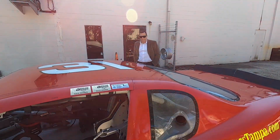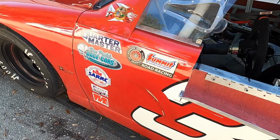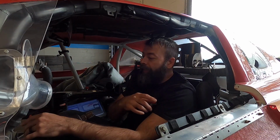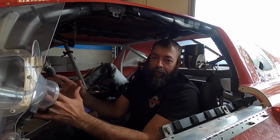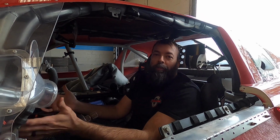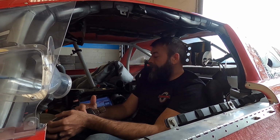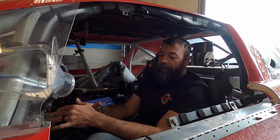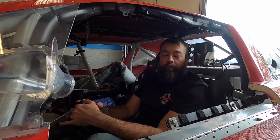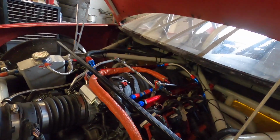Really curious to see how the changes that you've done are going to play out. So yeah, this would be awesome. Racing is racing, brother. I've been tweaking on this, and LAZ is behind the camera right now. We're probably going to mess around with the set screw a little bit, but right now it's idling at like 1800, and we don't have working O2 sensors. So I've got a couple of things fighting us. We're going to try and do a base run here and then work out all the problems. This is an awesome, super amazing car, but we've got a lot of problems ahead of us, and we're going to try and solve them. So let's get to it.